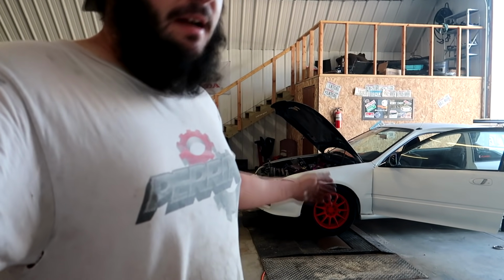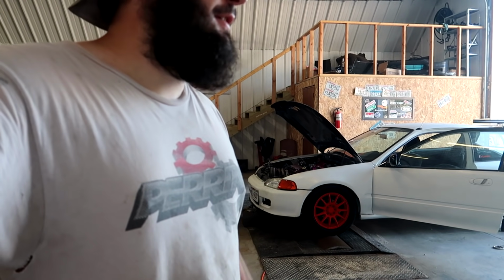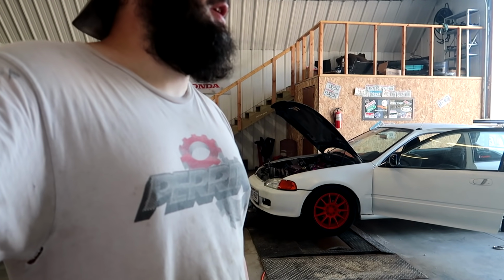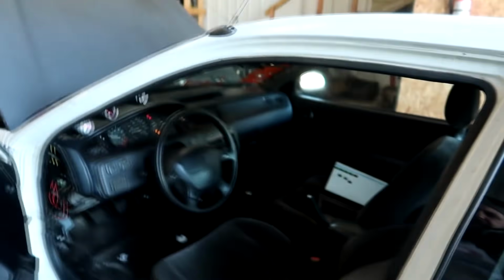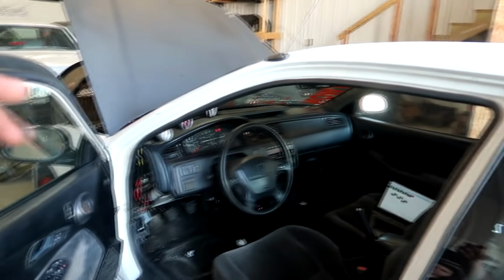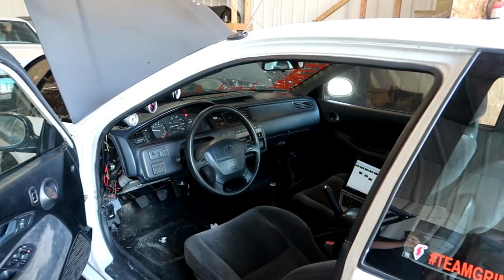Again, I'm letting it get warm. I'm gonna try another run, see if it does 240 again. The more I run the car, the more I can get the thermostat to crack. It's just super sticky, like it doesn't want to open. Now it's opened and I have heat inside the car again, and the temp is down to 197, but it was 232 degrees like 2 minutes ago. By leaving it run, getting that thing to crack, brought the coolant temp back down.